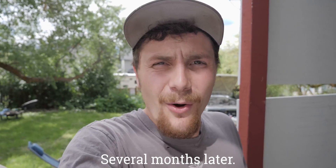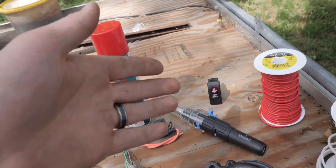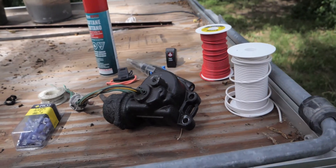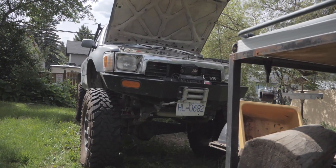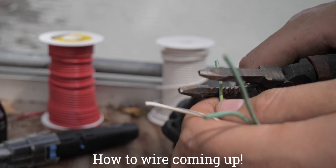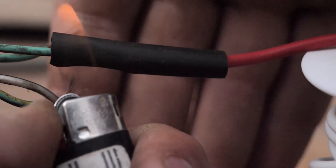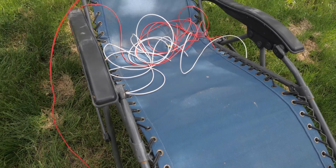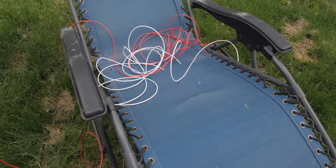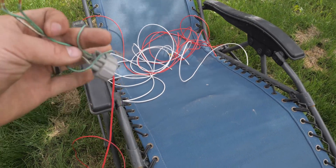Let's wire it up and see if we can get it going. As you can see I've got everything here to do it: connector to attach to the e-locker switch, solder, inline fuse, e-locker plug and harness. What I've done is made five of these ten-foot sections of wire and I'm attaching each side to one of these connectors. I'll run them to the truck — obviously the wire color isn't going to match, so I'm going to take notes on each side before I actually put it in.